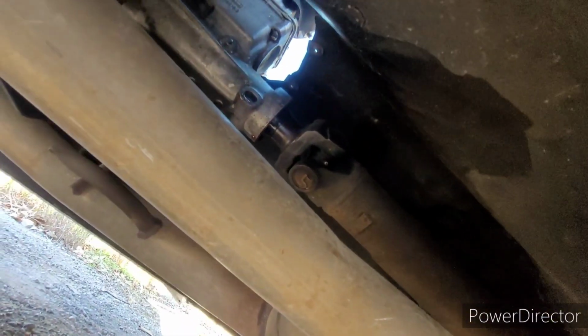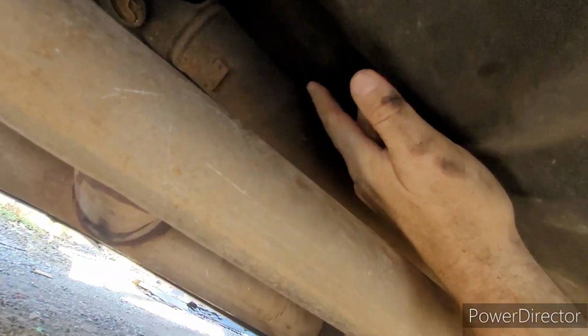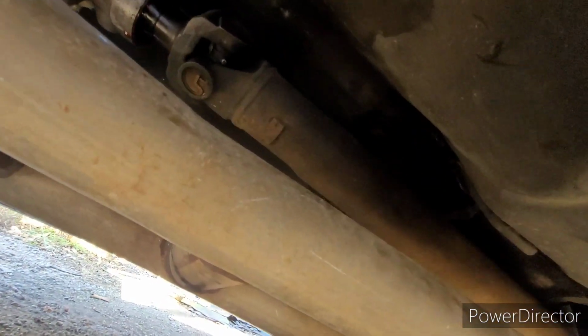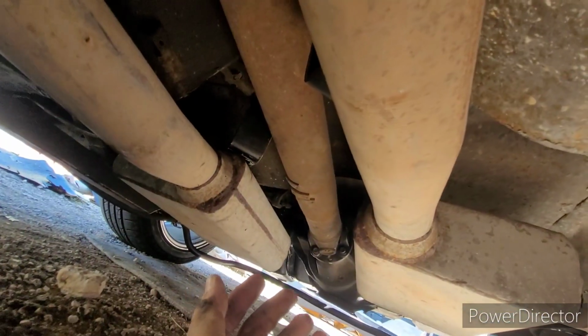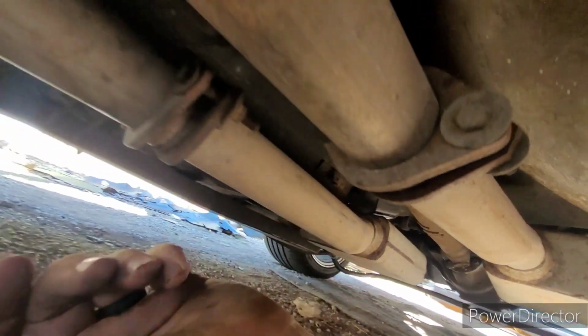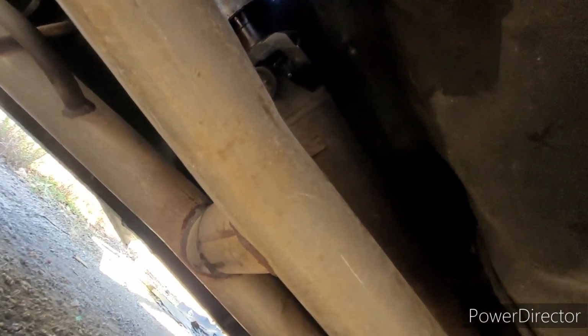All right, well, the dimensions on Chris Jr.'s 82 are different than my 86. My drive shaft safety loop just slid right up and in without touching anything. Junior's car, the drive shaft safety loop will only come in back here in the back, but then it hits the e-brake cables. It's hitting the e-brake cable and the mufflers. We're going to try pulling the mufflers, which works for us because we were going to try to do tailpipes here soon anyway, so we'll just weld on them while they're out.